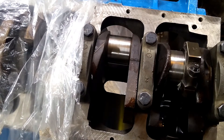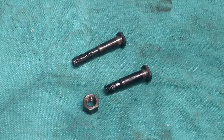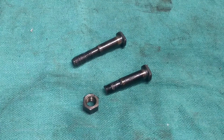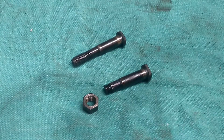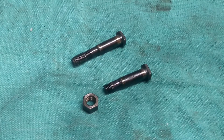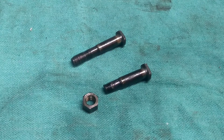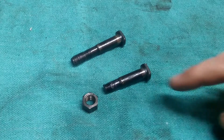That can't be good. So I have a confession to make — this may shock you, but sometimes I'm wrong. Sometimes I do make mistakes, and I even admit it. You may have just noticed in the video that I just broke off a connecting rod bolt — snapped it clean in two. What I had originally done was I looked up the torque spec for the rod bolts on my phone, and the number I came up with was 75 foot-pounds.